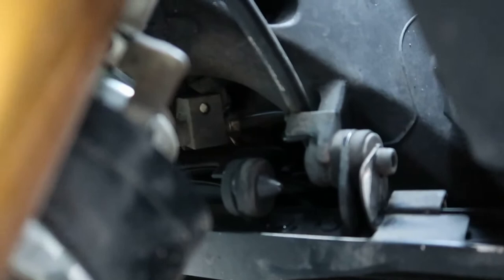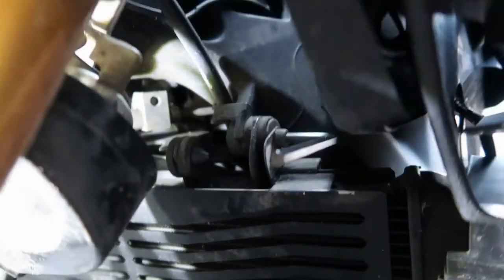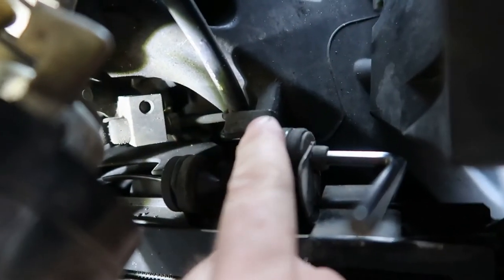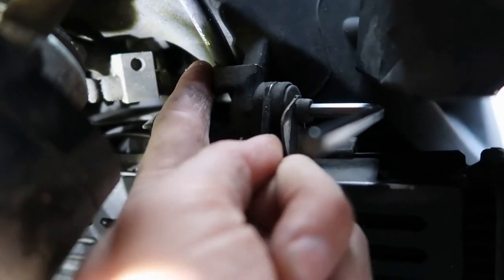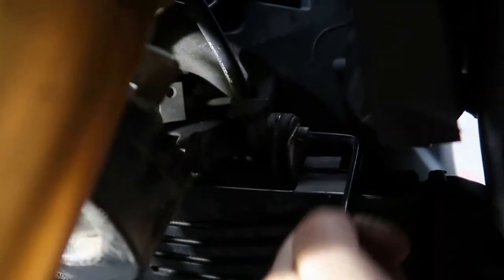Here's this part next to the radiator — that's going to be a problem. We can see this little plate here: it hooks up around the cable and holds it in place. I'm going to use an allen key to loosen off this bolt, then that plate bends down and I can get the cable out from behind it.